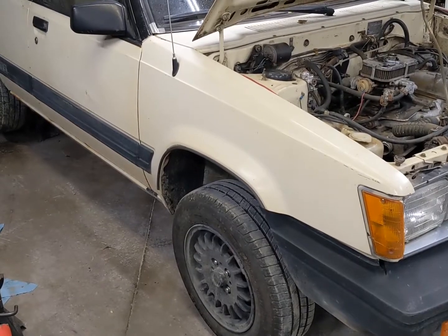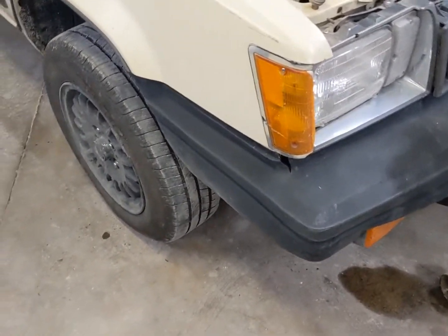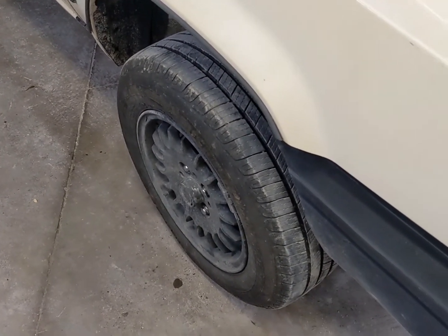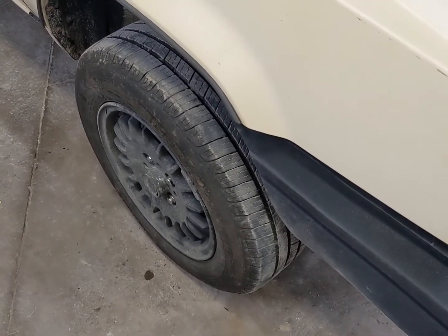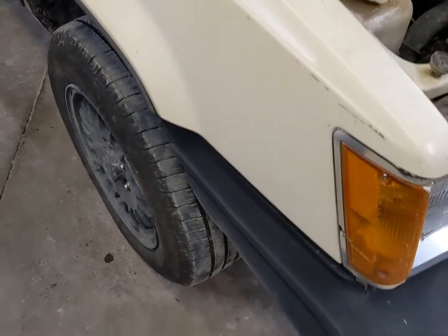Well, the GoPro died, so I'm going to finish this up with my mobile device for now. Got all the wheel put back together, got the wheel bearing torqued down, got the cotter pins all in. It definitely needs an outer tie rod end, so I'm going to plan on ordering some tie rod ends for this car. I've never done them. I've had it for 2 years and over 20,000 miles, I believe, I put on it so far.